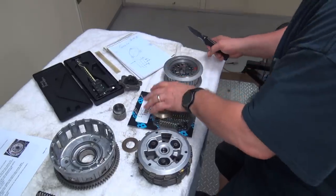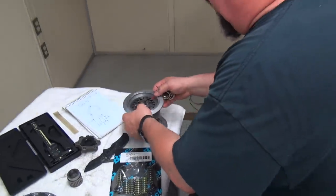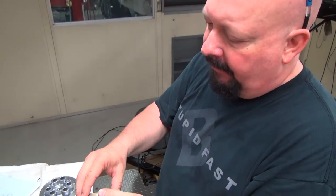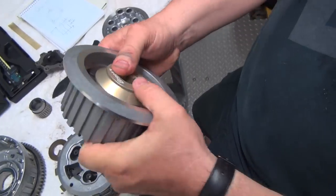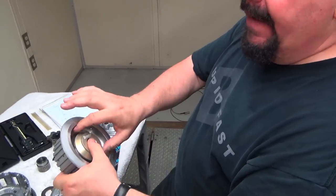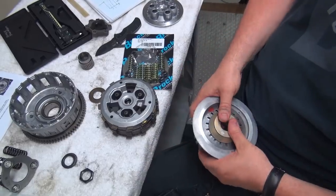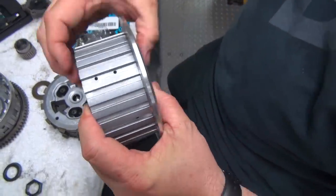We're going to replace the two-piece limiter with our one-piece limiter and make that nice and solid. This is our ultra mod for the GSXR 1000. Our instructions recommend keeping two of the Belleville spring washers. If you put this on here, you can see the fit is exceptionally nice — it is in there tight, no slop. The Belleville springs just help stabilize it from the face because you can get a little movement; we want to take out any movement we can. Once we clamp it, this will be a very solid piece.